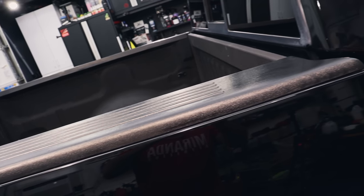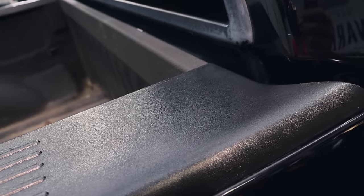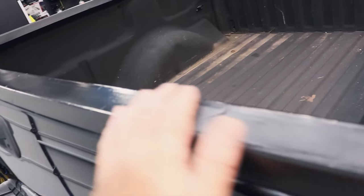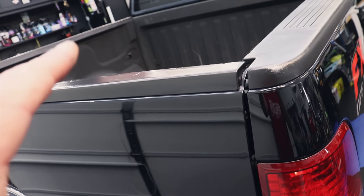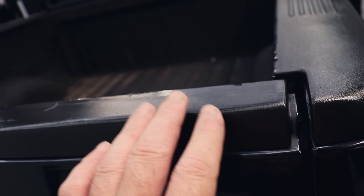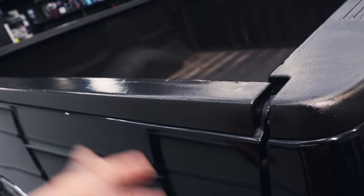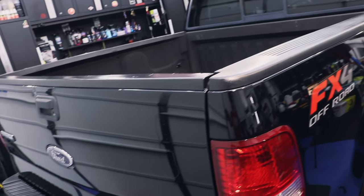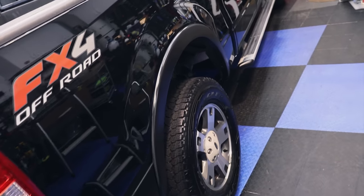It's not gray anymore — not bad at all. That faded trim is now restored pretty well. You'll see some weird patchiness because the plastic just absorbs weird, and that's after two coats of evenly applying it. This looks way better. I know it's still a little glossy but that will die down over time. Way better than having it faded and ugly. With faded gray plastic, I've tried coatings and other things, and sometimes it works, sometimes it doesn't — this is more of an extreme measure where you basically need to paint it rather than spray painting with overspray issues. Simple and effective.